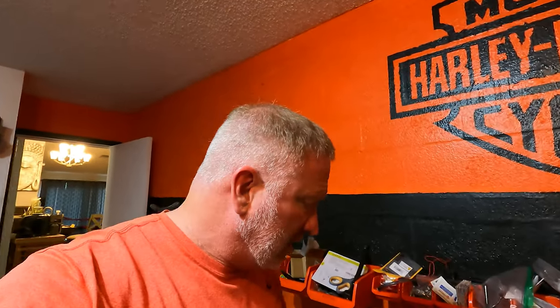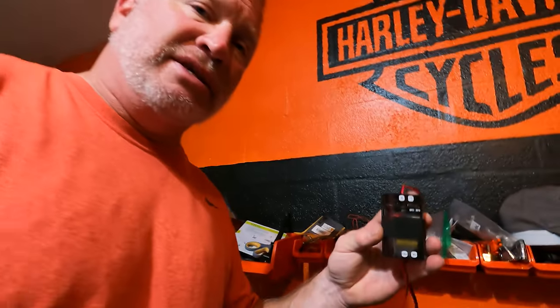And I talked to him briefly. And he recommended these. Oops, the one I just broke. He recommended these custom crossover boxes that he makes for this situation. Apparently you can't wire the tweeter just to the speaker because you could blow the tweeters, and I didn't realize that. I never really had tweeters my entire life. So these are high quality tweeters, but I don't want to blow them. So I got these custom crossover boxes from Carlos. Check them out at NVS Audio.